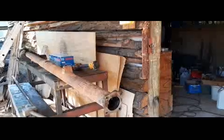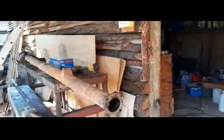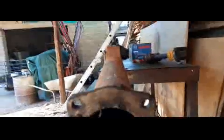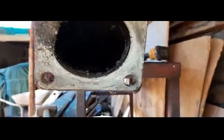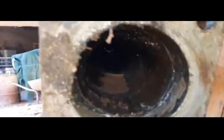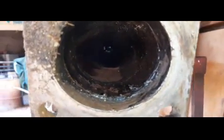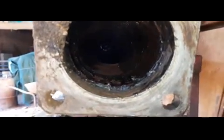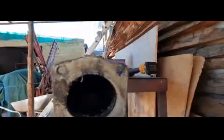First thing we have to do is to check if there's any rust in the torque tube. So maybe we can see if I go down a little bit more on this and put on a little bit of a light. And you see there's a little bit of rust in the bottom here. You can't see much, it's a lot of grease. It's now turned upside down. The grease nipple is pointing to the top. So let's go and see what we can fix about this.